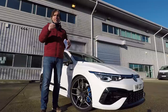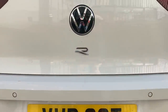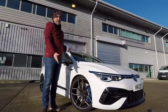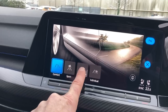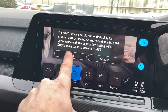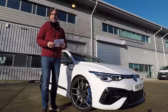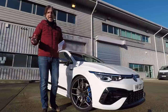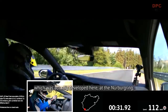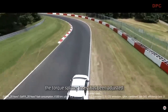It's a 2021 car in pure white — that was the free colour; you could pay more for lapis blue or deep black. They haven't, but they have spent money on the performance pack, which gives you the big spoiler at the back that works at speed to push the rear down, and it also looks really cool. It gives you 19-inch wheels, which have been swapped on this car. It gives you the drift mode, which is a bit of a gimmick frankly, because all Mark 8 Golf Rs have the torque vectoring rear diff. But what it does give you that matters is the ring mode — all Mark 8 Golf Rs have torque vectoring rear diff, and the fastest Nordschleife laps in Golfs are run with dampers in soft because the ring isn't a smooth surface.